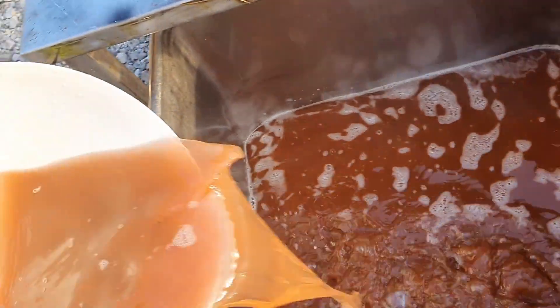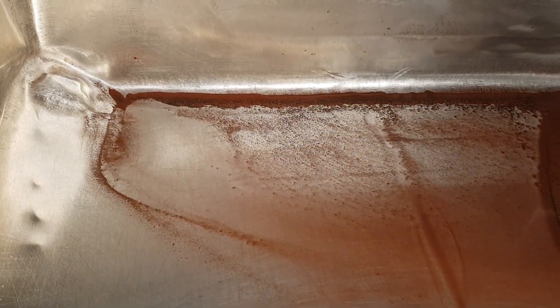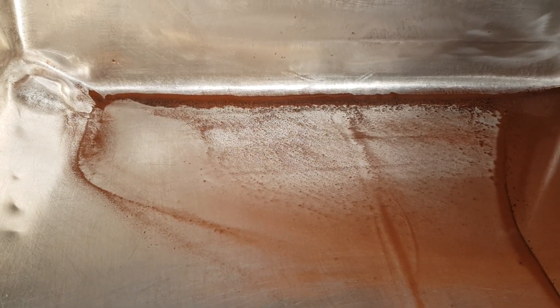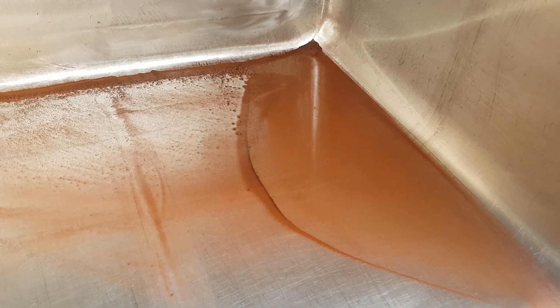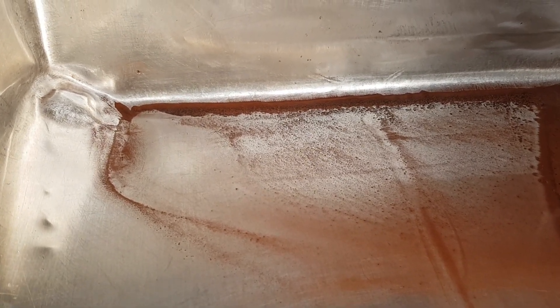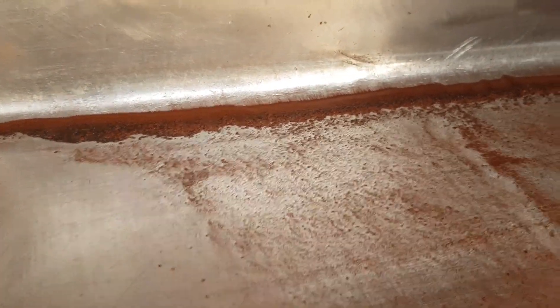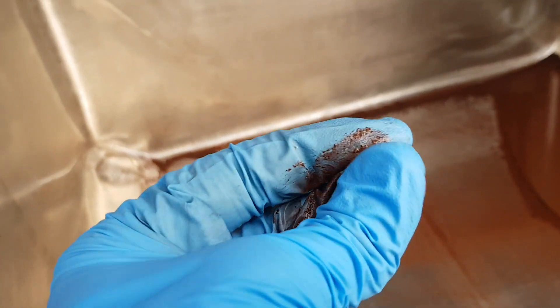This is all ashes — the amount of ashes that have come out of this DPF. These are just the big particles that got stuck when I was draining the bin. You can see all the brownish, reddish watery stuff that leaked out. The only thing left here is really large bits — it looks like if you crumble a brick, and it dissolves when you rub it.